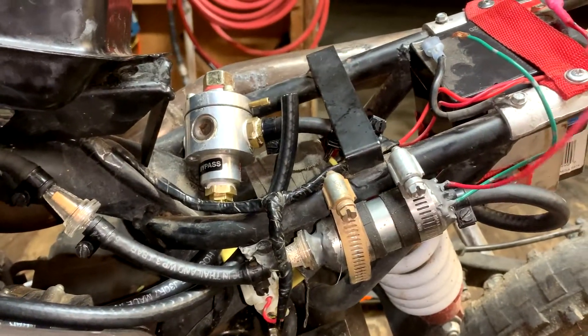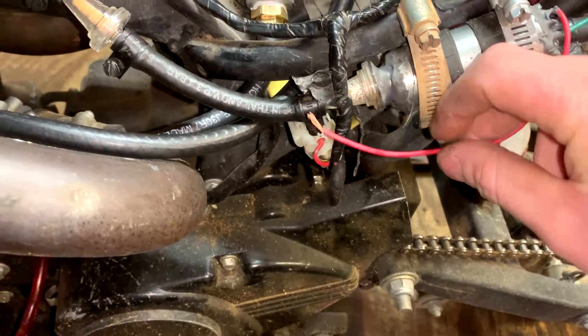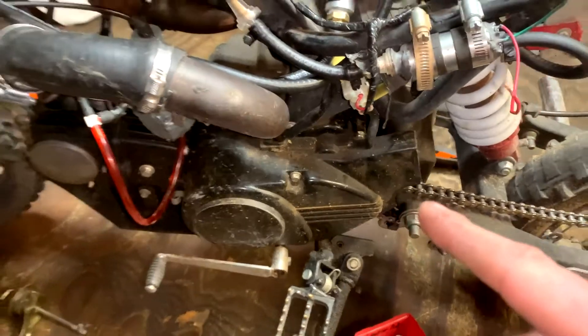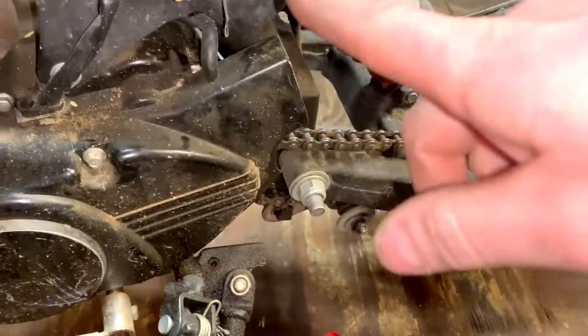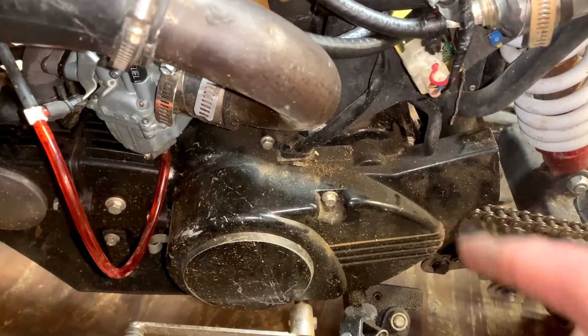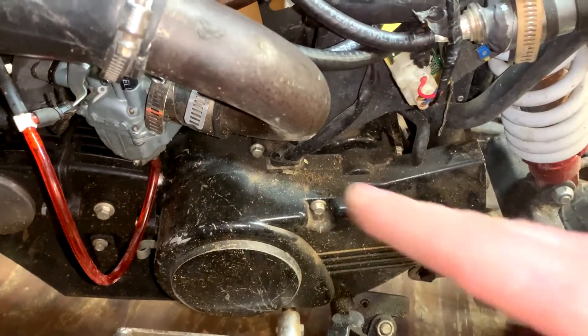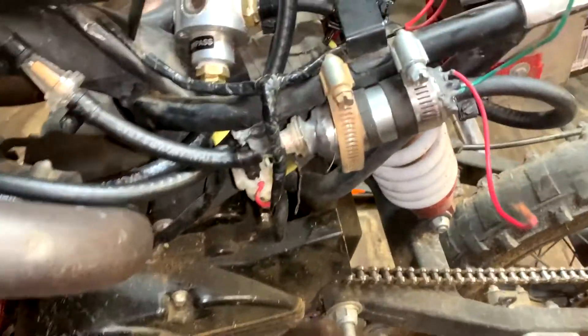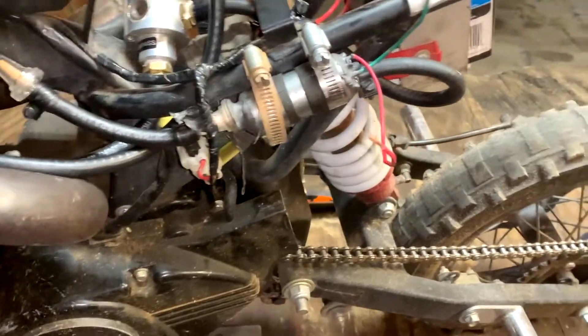The fuel pump wire I'll tap into the CDI because I have a DC-fired CDI system, which is adjustable so I can tune the timing curve. The ground I'll run up to the battery. These originally come with an AC-fired CDI system, but I wanted the DC one because it's adjustable and super easy to start - no matter how slowly you kick it over, as long as the pickup coil senses it passing by the magnet it will fire a nice hot blue spark. The only downside is if your battery dies, you lose spark.